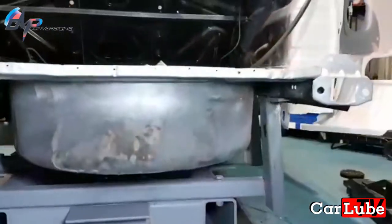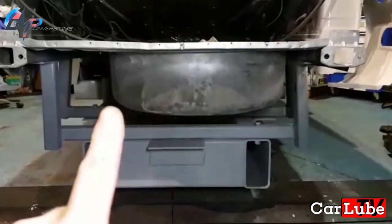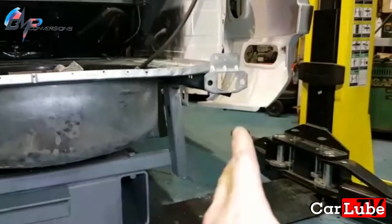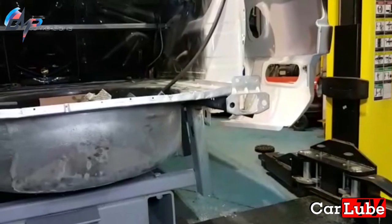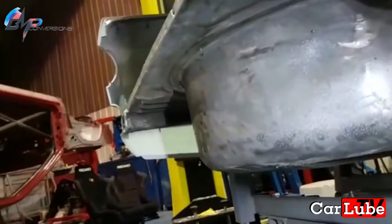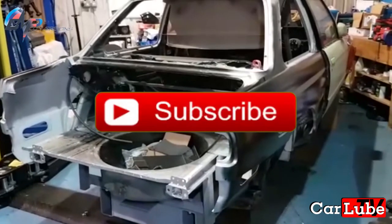There are a few more areas I need to clean up before I do this - areas like the wheel well at the back here, purely because we're removing every piece of under sealer on the car from front to back and renewing it with brand new paint. These are areas like this wheel well and along the chassis rail up here that you won't be able to get to with any kind of wire wheel, especially when the carbon fiber tray is in here - you don't want to be going near that with a grinder. So I'm taking them back to bare metal just under here. Once the back panel goes on you wouldn't have access to get anything up between there to get the under sealer off. So - forward thinking - get all that removed before we put the back panel on. Once the back panel is on it is literally ready to weld.